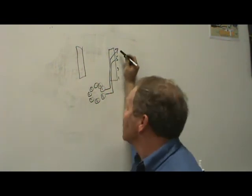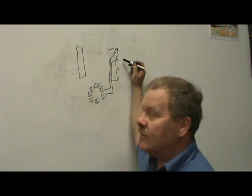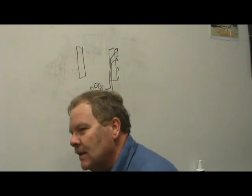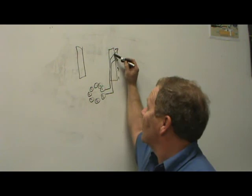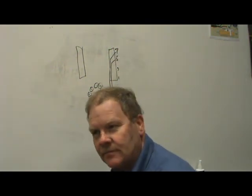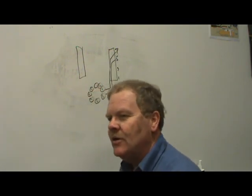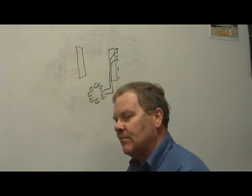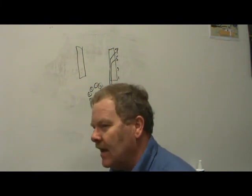And what happens is, where is this cylinder here? When this one fires, where is that one? Look at the firing order, guys. When this one's firing, where is that one? It's coming up, on its way up. Because it's coming up, the fire that was induced in this wire going to that one is now firing it early. It knocks on that one cylinder, and you pull the spark plug out, and it's destroyed, because you've got some heavy-duty explosions going. You've got your air-fuel mix, you're squeezing it, but you ain't ready to pop yet.